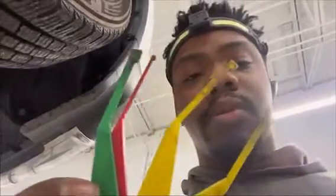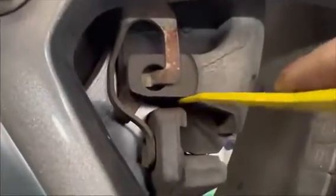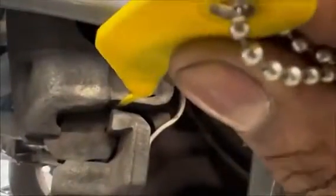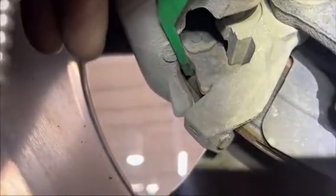These are brake pad measuring tools — yellow indicating that they all need attention soon, red meaning they're unsafe, and green meaning good to go. The tool allows me to accurately check the pads without removing the wheels. So far, you're at more than 5 mil on this side pad, but on the right outside pad, you're at exactly 5 mil — see how there's no play. I'm going to go ahead and recommend a front pad replacement. They are safe, but they're going to be needing attention soon. All of your rears are in the green at about 8 to 9 millimeters.